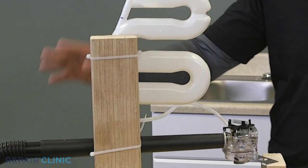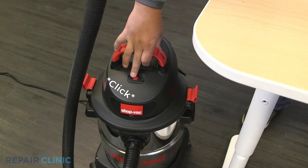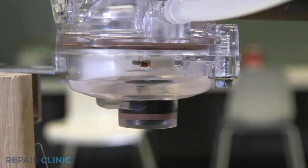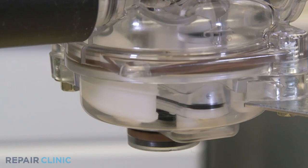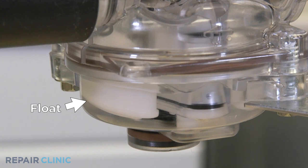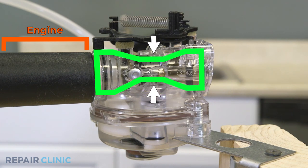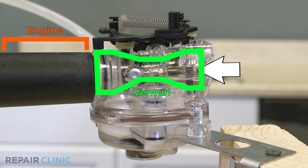This will act as my fuel tank and the vacuum here will act as my engine that's stuck in the intake stroke of the four-stroke process. The carburetor prepares a mixture of fuel and air for the engine to run smoothly. The most common carburetor used in small engines is the float-style carburetor. It consists of an open pipe through which air passes into the inlet of the engine — the pipe is in the form of a venturi, meaning it narrows at a section and then widens again, causing airflow to increase in speed at the narrowest part.